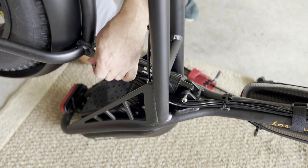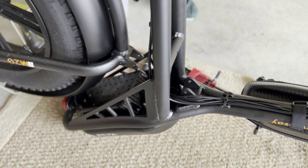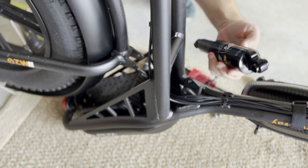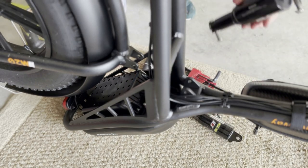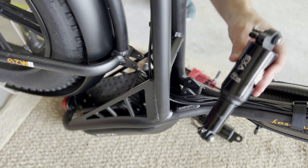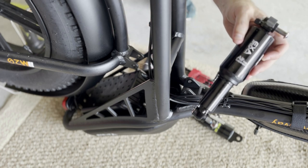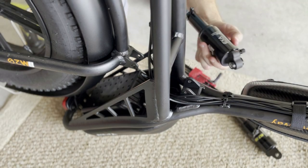Be careful moving this. The back portion of the bike comes down — you can rest it there. The old shock is rated at 750 pounds, it's oil-filled, and has no adjustability, so for heavier riders it probably works well. But this new air-filled shock is fully adjustable on two different chambers, so you can really dial it in for your riding weight and height. It should also provide a better ride and give some dampening.